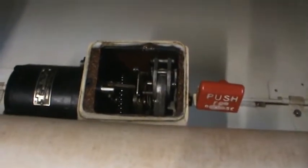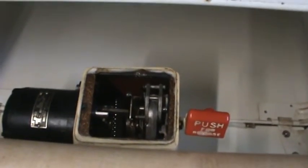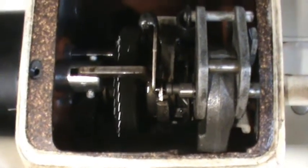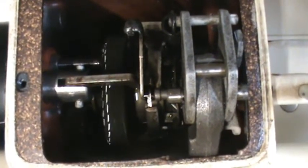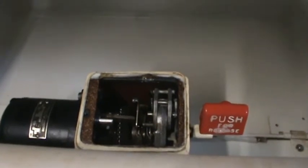Once you've got your new oil in and your keys freed up, make sure your levers are operating as they should. I also applied a little white lithium grease on the different pivots for the knee adjustments, which freed them up quite a bit. Here's one more full operation demo: engage — cam is engaged now. If you push the red emergency lever while the cam is engaged it is super loud, but I think that's how it's designed — it's really just an emergency operation. You can see the cam reset when pulled back into place.